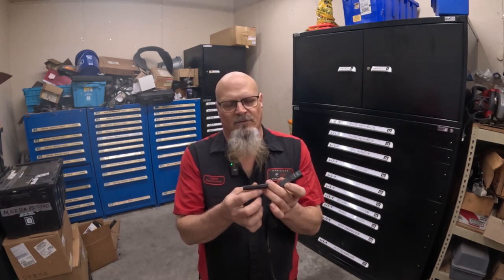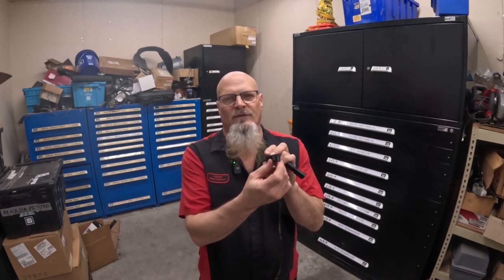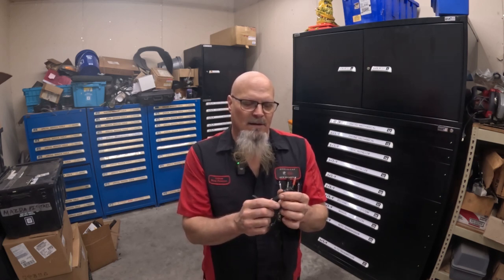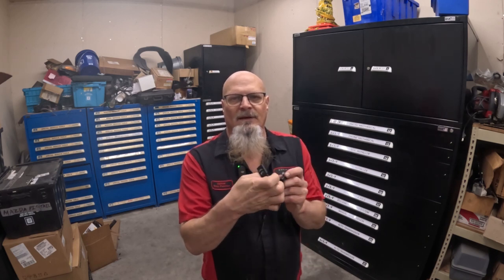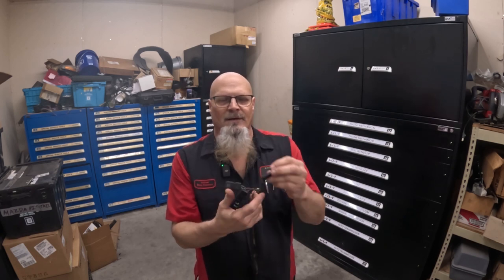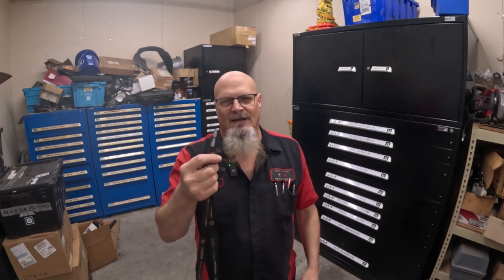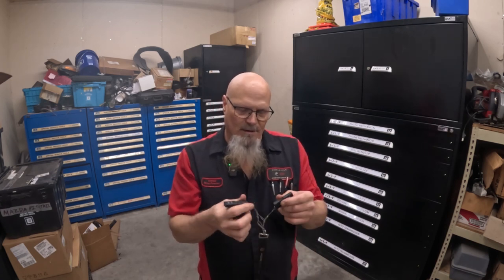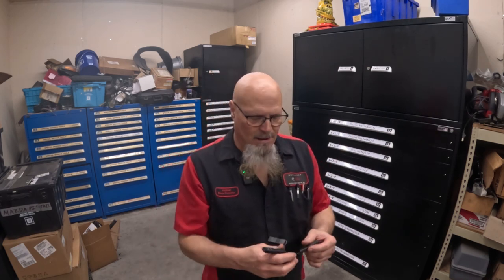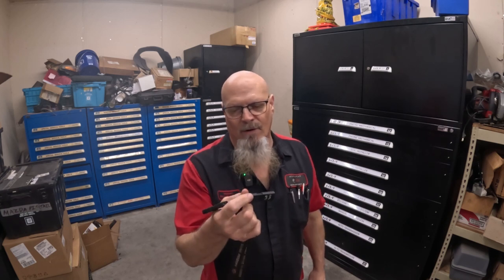This one starts with 31, that's super old. This one starts with 33. The reason I have them on here is that way back in the day, you could not update unless you were updated to 31 first. If you needed to get to 33, you had to do 31 before 33. And if you needed anything higher than 33 and you were below 31, you had to do 31, then 33, then the new one. I haven't actually seen these older ones in a very long time. I've even thought about taking them off of here, but I guarantee the second I get rid of them, an old car will come in and I'll need them, and it's hard to find these older programs through Mazda. I could probably find them, but I have them right here.